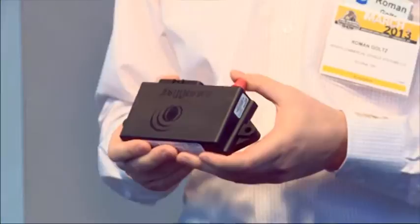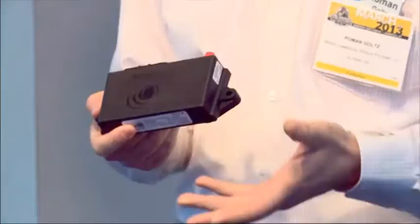Here are the few pieces that you would have to install on the vehicle. Starting with the main ECU — this is the TPMS ECU — that normally goes right near the front steer axles, by the front bumper. You could mount that outside underneath the vehicle. This little unit actually picks up the sensors that would be mounted in your steer tires at the front of the vehicle.